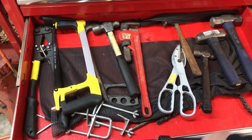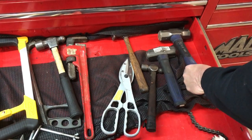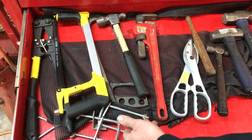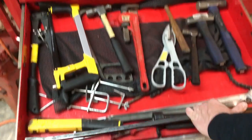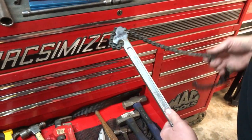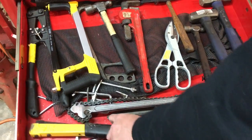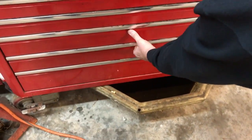We have some hammers and big tools here — a four-pound sledgehammer and a three-pound drilling hammer. A four-pound sledge is about the biggest you want to use on an automobile; anything bigger and you'll probably tear something up. A good pipe wrench is always handy for tie rod ends. A hacksaw, a pry bar or full pry bar set would be great. There's also a chain wrench for holding a crank damper to break a crank bolt loose — useful if you do a lot of timing belt work. A lady foot bar might be handy to have as well.